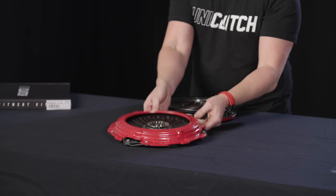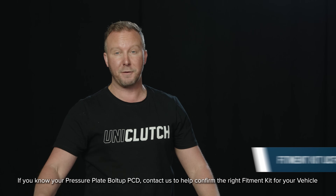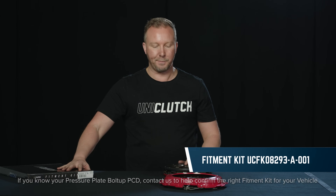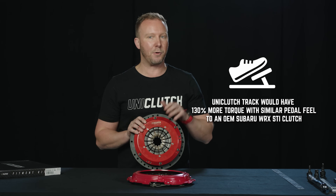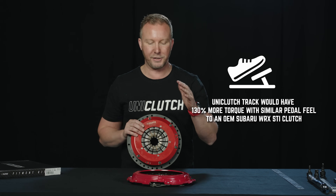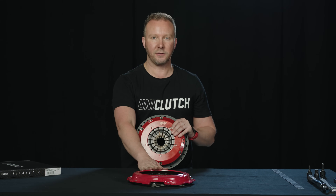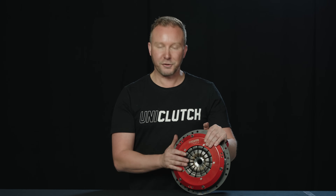We get a lot of questions about people with pull-type clutches. There are a few Japanese sports cars from the '90s and 2000s that run a pull-type clutch — for example, this one off a WRX STI. We can see the bolt-up PCD of this STI clutch is easily bigger than 248mm, so we know we're going to be able to get a UniClutch for it. In fact, this is the right fitment kit — the 293 kit — which has the right bolt-up and spline for the STI. However, it's a pull-type clutch, whereas UniClutch is push-type. Push-type clutches are far more common, and there's a big aftermarket for pull-to-push conversion kits. That changes your factory transmission from wanting a pull-type clutch to the more common push-type, so we definitely have a fitment kit to let you run UniClutch with the STI or really any other pull-type clutch.